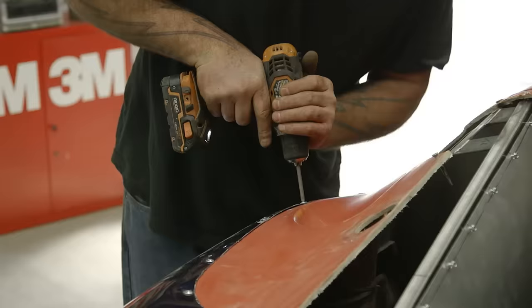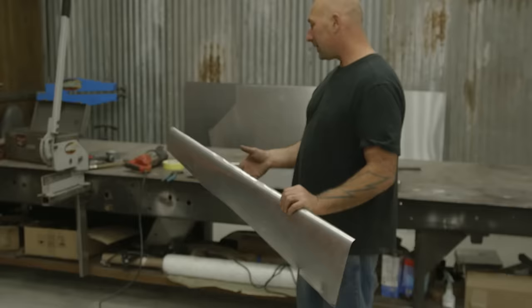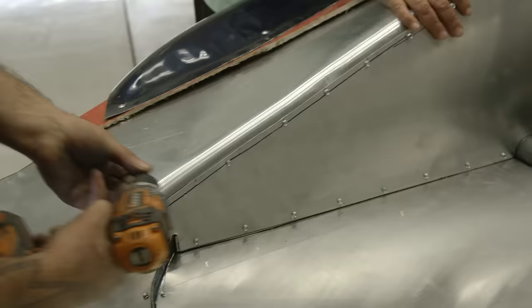The idea of screwing this Porsche quarter panel onto the Sterling body seems kind of strange. That ain't strange — that's like crazy. Yeah. Madman. Now I'm getting excited again. So what I was thinking was I just took this aluminum sheet — super light — and I just formed it over a piece of tube. That way it'll radius down into the engine compartment really hard. So it's just going to pop on here and represent a surface, just like everything else we've built so far.